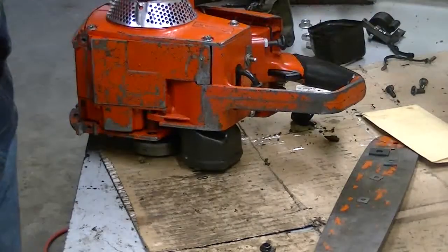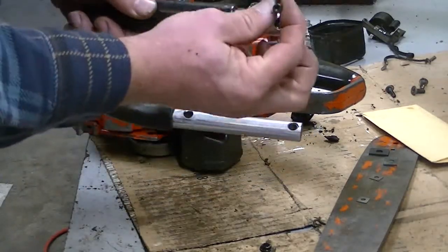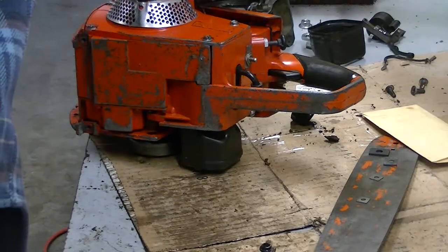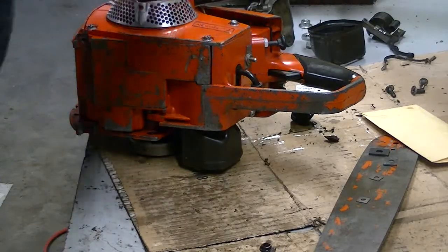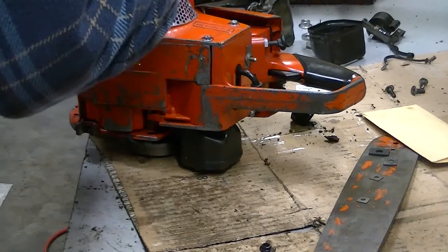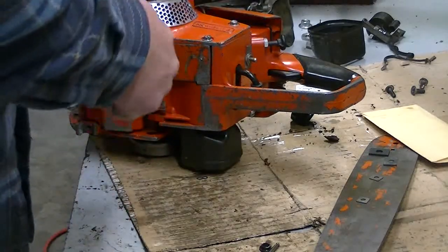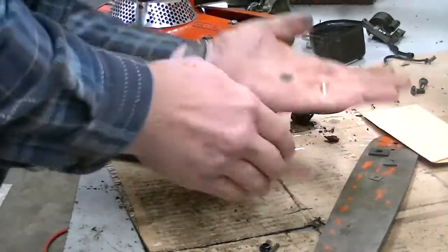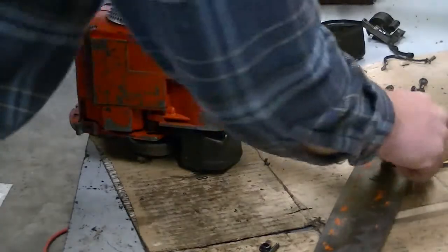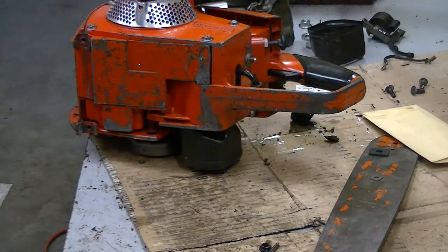So on the rest of the saw, you've got a standard mount on the top for the main handle that uses a regular socket head screw. That's a tight, solid, firm mount. The bottom, you see these are pretty big holes, and again, these use a special shoulder screw. And the handlebar itself gets another set of these rubber liners. Those were actually in pretty good shape, so I'm reusing them, but the rest of the components that were supposed to be down here were missing. And those are a set of steel plates, and there's actually small indentations here, and then a set of rubber pads that will go over top of those between the mounting point and the handlebar, and that's what creates your cushion down here.